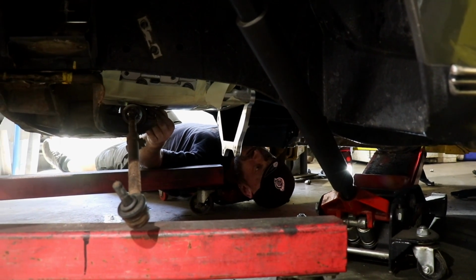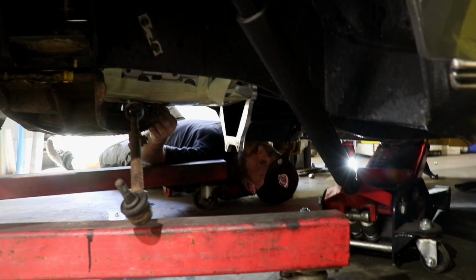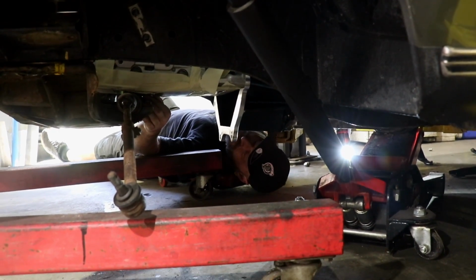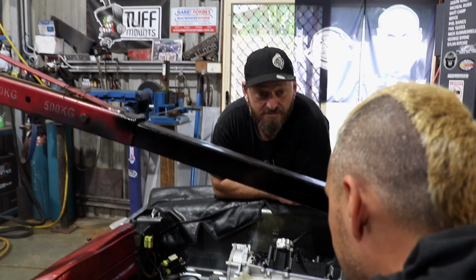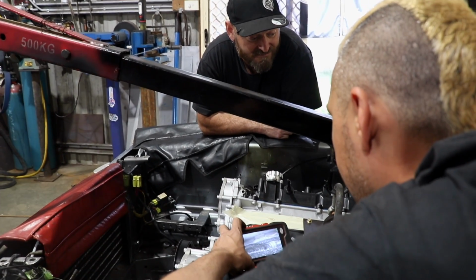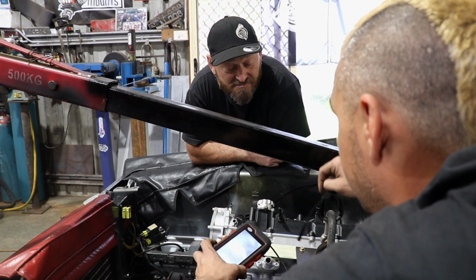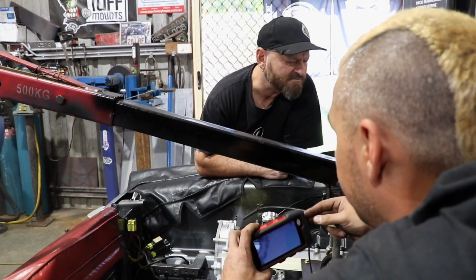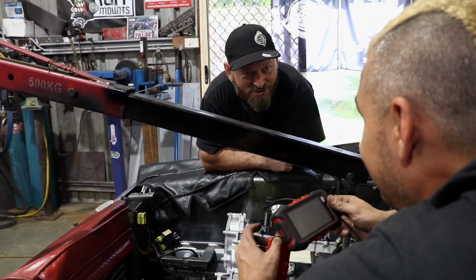Yeah, well, the only way we can do that is to get the... Or you have a uni just on the firewall and another uni further down. Yeah. Oh, there's like a bolt or something on top of the gearbox behind the bell housing? It's a shifter detent. There's a spring and ball and spring thing in there. Can we do like a Hoff inspection hole? A hole saw out the top of the tunnel for that? Because that's what's holding us back. Industry standard, isn't it?